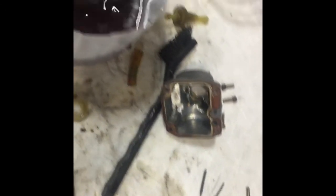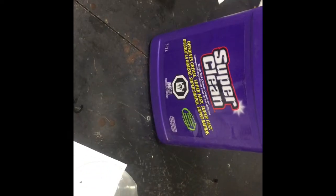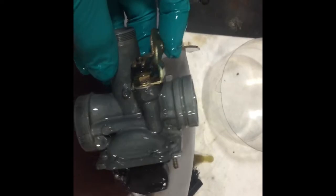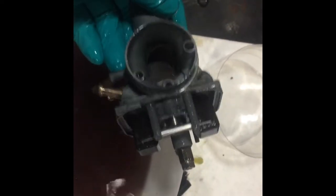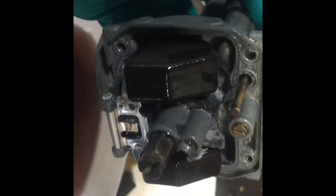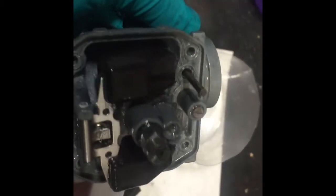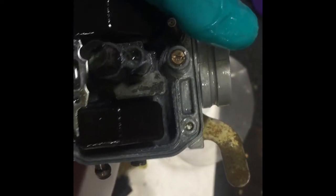So I was reading online and I thought I'd just try some of this Castrol Super Clean. It's pretty corrosive, it cuts grease really well — this is not a paid endorsement. I cut it with hot water, about 20% Super Clean, and scrubbed it a bit with a toothbrush. I should have shown a before picture, but you can see a bunch of green crud in there — it's coming off though. That bright green stuff in the main jet was actually all over the outside of it; now it's all gone after only about an hour of soaking.